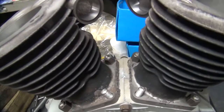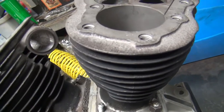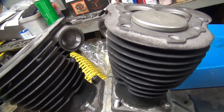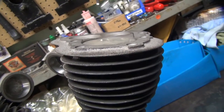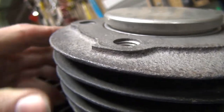Alright, we've got our cylinders up on this motor now. We've got to do a little bit of light trimming on the back of the rod here within the cylinder. Even though it cleared before, this crankshaft is different than the S&S we had in there before — had to make it fit. You can see how much pop-up we've got here. It comes up pretty good — definitely comes up to the bottom of the top ring.